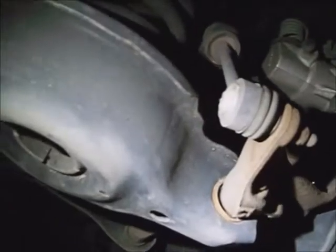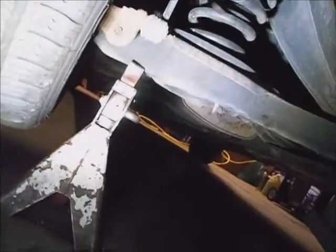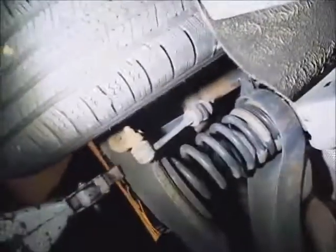I'll install a jack. I've gotten this off to the left side of the spring on the lower control arm. I'll be setting a jack stand on this blunt area underneath the spindle on both sides. It looks pretty good — both of them on the ends, or actually next to the coil spring on the lower control arm. I'll go ahead and take the wheels off.